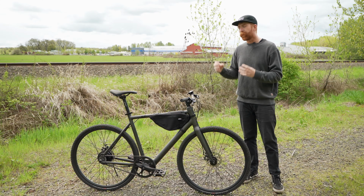All right, let's talk about the gearing ratio right now. Right now I'm in pedal assist mode 5, decent incline, but it coming with an almost 3-to-1 gear ratio, pedaling up this steep stuff is kind of a lot of work. Not quite getting the cadence I wish I had unless I stood up and sprinted it, but having that pedal assist 5 and a 350 watt hub, be able to get up it, no big deal.